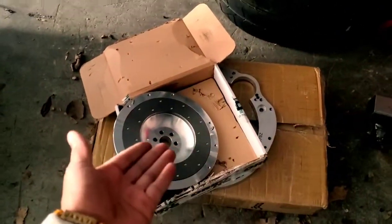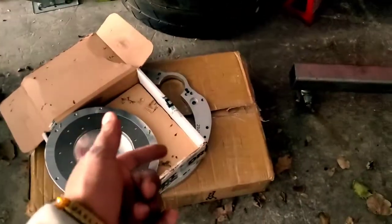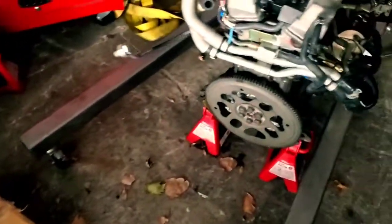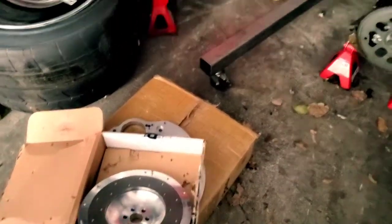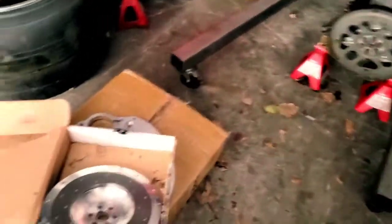There's another video I will reference in the comments that helped me out a lot. They notched the bell housing just to fit the starter because the starter housing was bumping into the bell housing of the trans — but that's literally it. Another thing about this kit is it converts the clutch system to a 350Z / 370Z clutch. Once you run this and bolt everything up, the RB25 clutch will not work — it will have to be a 350Z clutch.